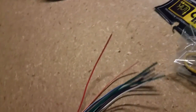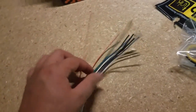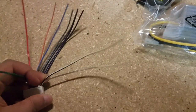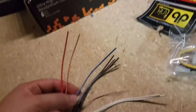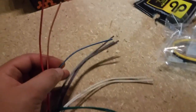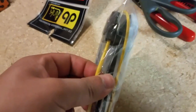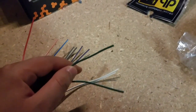First thing I like to do is identify the wires we're going to be using. You've got your red wire, which is the accessory switch. This is your speaker wire — gray and purple also. Orange illumination. And then this blue with the white stripe is for your remote turn-on for your amp, if you have that to install as well. And of course you've got your constant 12V, which is the yellow, and the negative, which is black. So as you can see, these need to be spliced, so I like to prep everything.